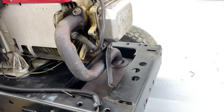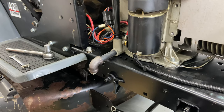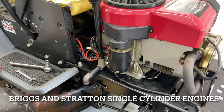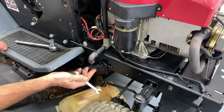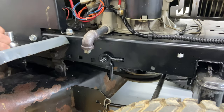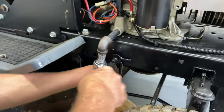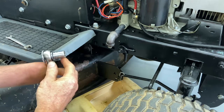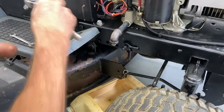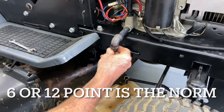You want to drain the oil first. This is an older model with a nice little drain right here. This is for a Briggs & Stratton single-cylinder engine with the Walbro carburetor that has the issue, so there's a lot of engines out there that this will work on. The drain plug here is 7/16ths square — a square plug. You can use an 8-point socket, which gives a little better leverage. And then you let it drain out — it's going to be a complete mess.